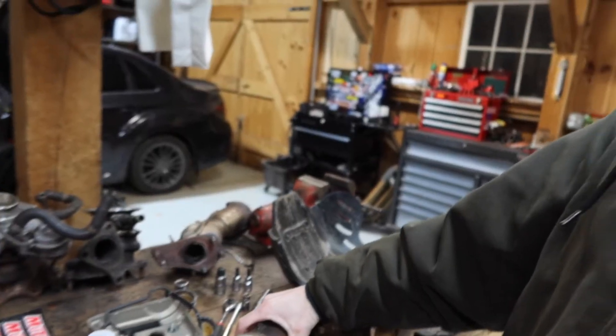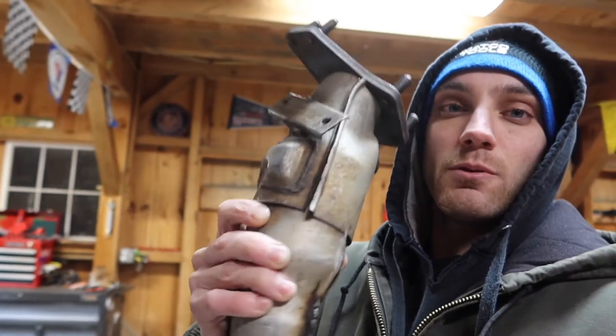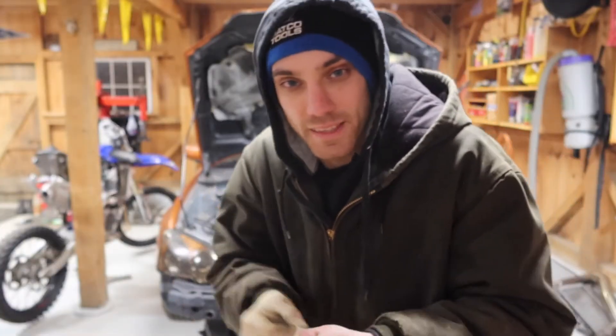We are going to be hopping onto the 2004 WRX here — the main project. We decided to take the external wastegate out that we had, because we are running a stock setup here: stock turbo, stock block, everything's stock. We wanted to try to run the external wastegate but we couldn't figure out how to run the vacuum lines. So we got this stock unit here we are going to put in. We're also waiting on an EGT sensor before we start that, and we have a set of four brand new coil packs for this thing. You know Subarus — tune-ups on these are probably the least fun things to do.